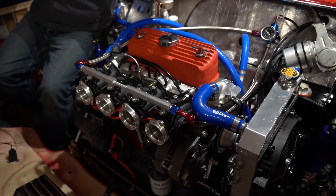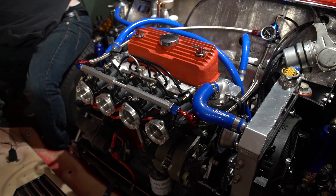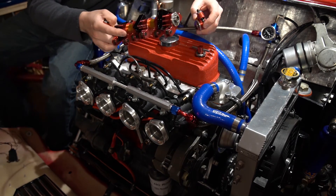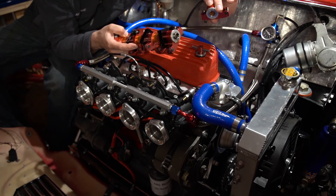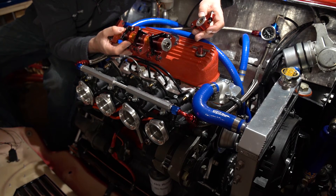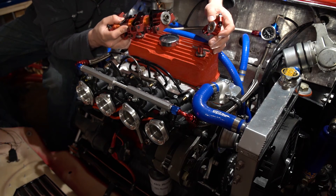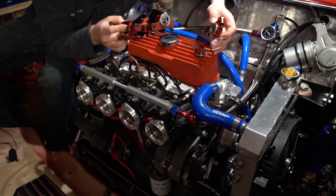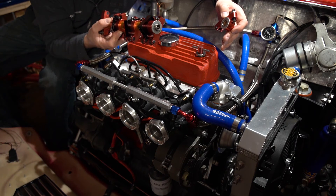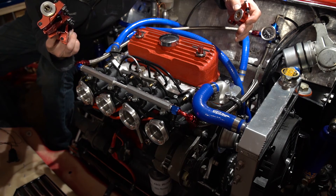A few of you have probably already seen this — I did have on there a set of 1.5 rockers. However, one decided to come off, which wasn't a good thing. So right now I've got a set of standard rockers on there, which may well snap, because I've had one snap before, as the valve springs are fairly strong on this head.